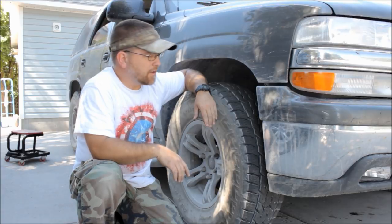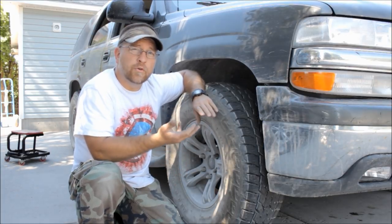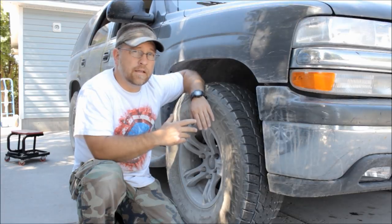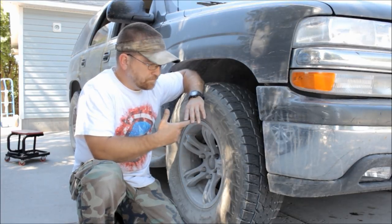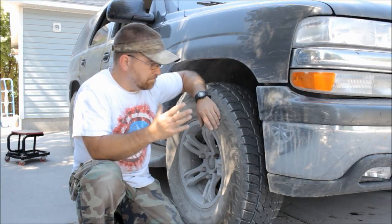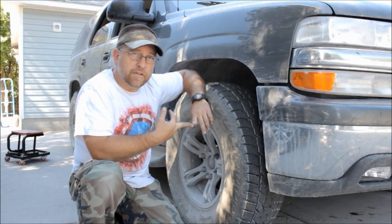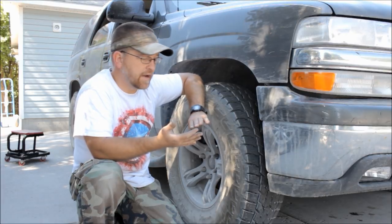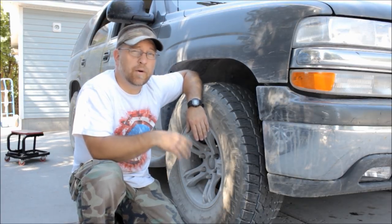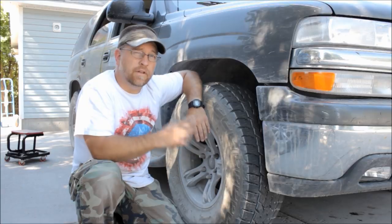Alright Bleepin' Jeepers, that's it for this follow-up video on the tire beads. I'm going to say this is legit — I've got no weird tire wear patterns, there's been no funky road noise, there's no damage to the inside of the wheel. Those airsoft BBs look just as brand new as they did the day I put them in. So I'm going to say that's a legitimate way to balance your tires. This is six months of driving and nothing out of the ordinary to report at all. The beads haven't disintegrated in the tire, there's been no damage to the rim or the valve stem. I'm so impressed that this is probably the way I'm going to balance my tires from here on out. It's just super simple, and it continues to balance over the life of the tire, which is great.